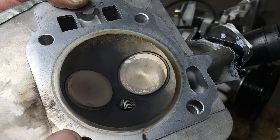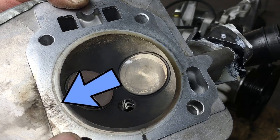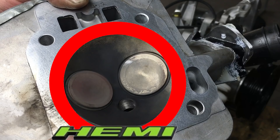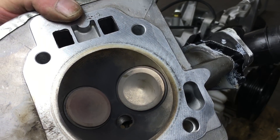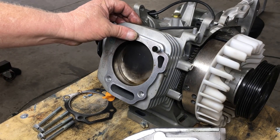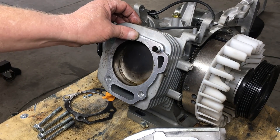Looks like something's going on over here. Hard to say what that's all about, but it doesn't look good. This is the Hemi version of the 420 Predator engine, and here we can clearly see the hemispherical combustion chamber. The word Hemi is often associated with Chrysler products, but the Hemi head has been around since the early 1900s and originated in Europe. The burn marks on the block are superficial, but I think the next time the gasket blows we'll tow the car back to the workshop.